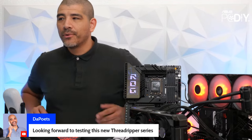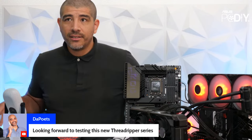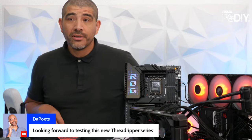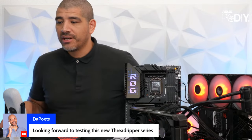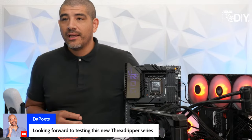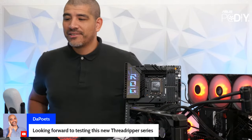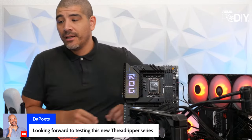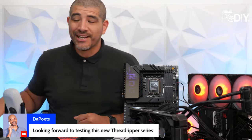DePoets says, looking forward to testing out the new Threadripper series. Yeah, it's a really impressive part. When you talk about the CPU range for the non-Threadripper Pro, you're looking at $1,500 to $5,000. You go all the way up to 24 cores and 48 threads. That's really impressive, right? You've got 48 lanes of PCI Express Gen 5. And if you go even higher, you can go to 64 cores, 128 threads. And then on the Pro series CPUs, you go up to 96 cores and 192 threads. So you talk about going from your minimum all the way up to your highest end. That's pretty crazy, it's pretty wild, right? That one socket is going to be able to scale all the way up to 96 cores, 192 threads. Pretty cool.